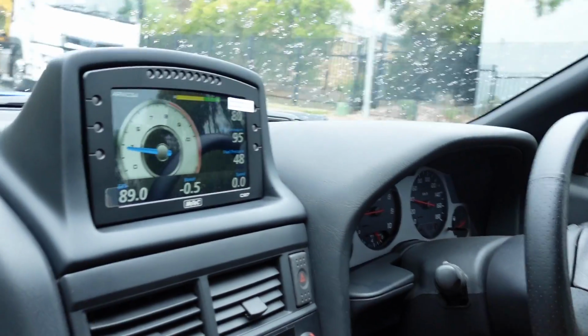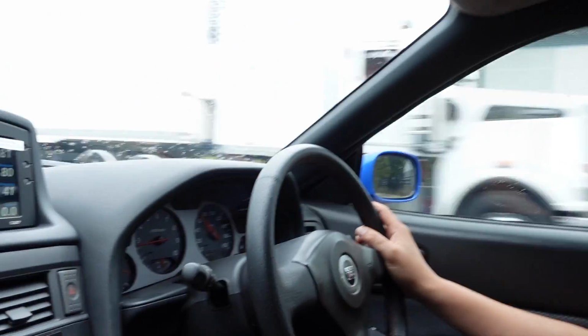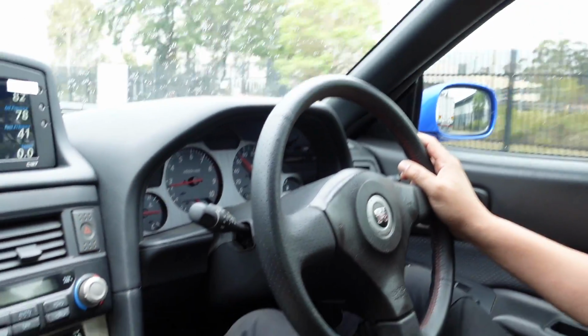So this car was brought in relatively standard. It had a Haltech ECU, did it? Yeah. So we put in an M1 package, a plug and play kit that Powertune do. So it's got an M150 now, and it's obviously got the C127 dash in the famous location where you should always put it if you respect your GTR. So you still retain all the factory fuel and obviously the cluster.